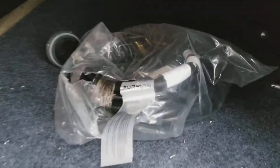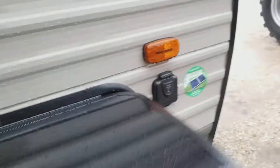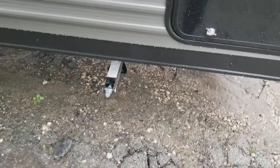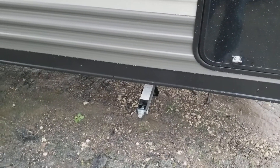Here is your storage on the outside. There is your 25-foot marine cord that we will give you for 30-amp service to hook up to the electrical device of your choice. And there is that little tool I was telling you about that you can use on the front jack to bring it on and off your vehicle. And that would be for your stabilizers on all four corners. The trick with your stabilizers is to get your 20-volt drill with a 3/4-inch socket on there and it goes down a lot quicker so you can level out your unit.